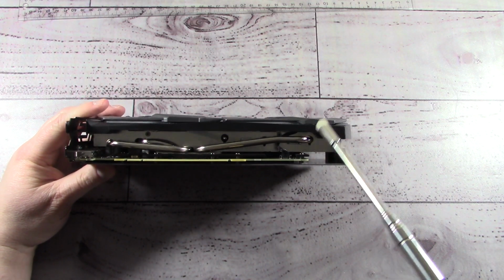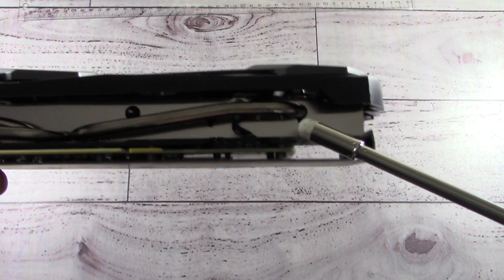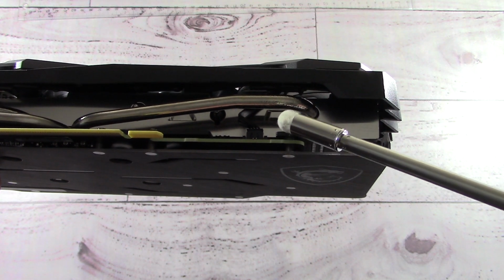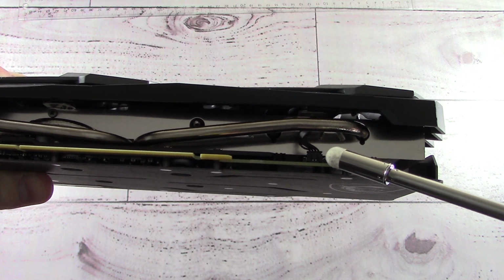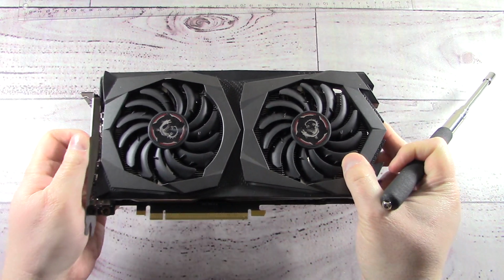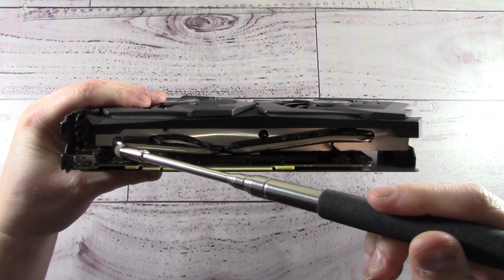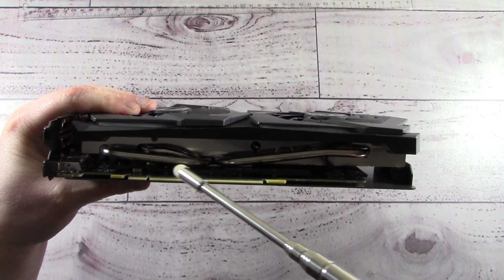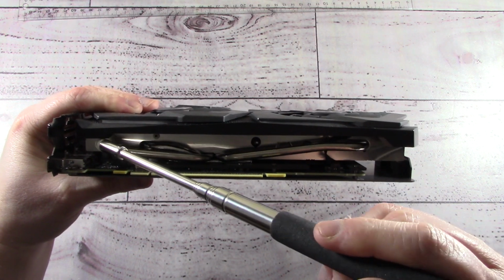But what's unique about this heatsink design, and you probably can't see it too well in this video, let's see if I can bring it up here to you. If you look right under this heat pipe, this little triangle thing that's right underneath this heat pipe here, there's one here and then there's one on this side, and there might be ones on the other side, but they're definitely on this side. These are basically air ducts, special air ducts built into the heatsink, and what they do is they direct air onto the heat pipe itself. So you see how the heat pipe comes out here? Well, usually that doesn't get a lot of air that flows over it on the edges here. But what these dispersion fins, let's call them, do is duct air onto the actual heat pipes coming out of the heatsink.